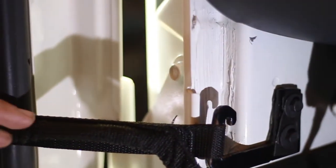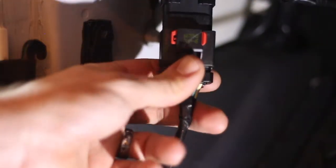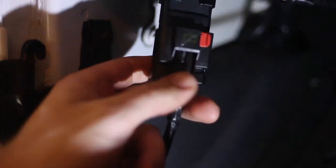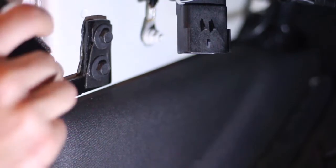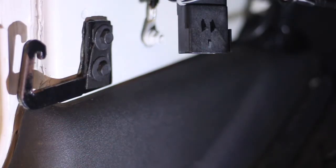As you open the door you'll see the strap connecting the door to the wiring harness and the door strap. I recommend doing the wiring harness first so you can get enough slack to undo the door strap. The wiring harness — all it is is the red tab, push to the side, push down on the bottom clip and pull. Then you can pull the door strap out. I also recommend putting the wiring harness and the strap inside the door card so they won't get lost or jammed when you take the door off.